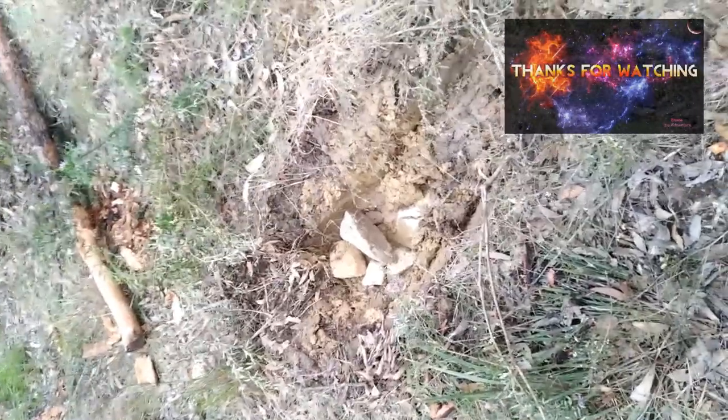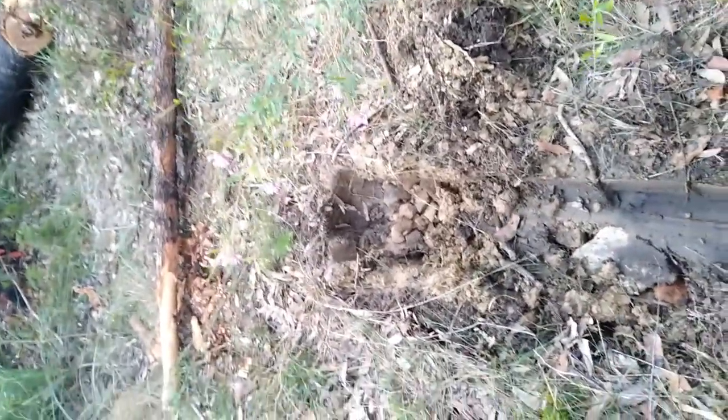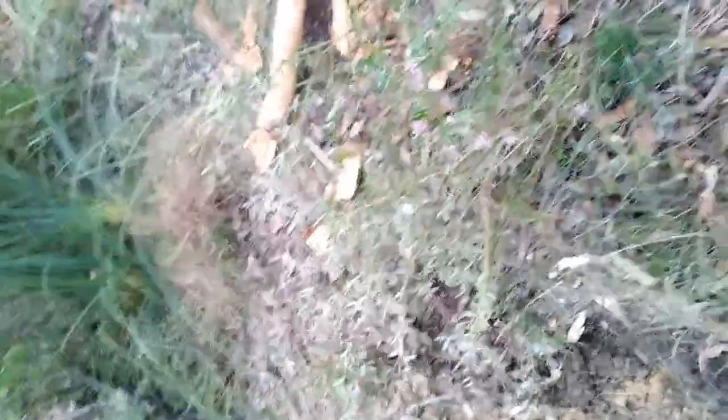A few hours later and we're out. As you can see, filled up the holes full of rock and just drove straight out after that. So the bush jack does work. It's just a 20-foot pole with stumps underneath it, as you would have seen in the previous video. That's your lever and fulcrum — just put it underneath your tail bar a little bit at a time, stick a bit of wedge wood underneath it, and just lift her up.